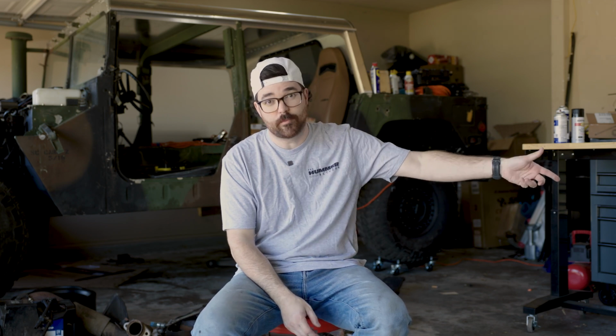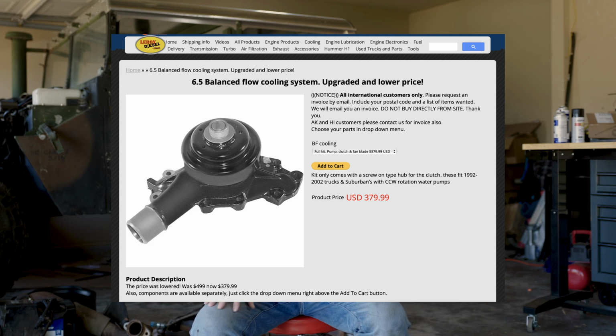So, that was the last video, where I did the fan. I got some feedback, started talking with some guys on the forum, and referenced a previous video, the water pump. Well, I put a new water pump on. I'm from the Jeep world. I didn't know there's reverse flow water pumps and the issues that can cause. So I put on a water pump. It's fine, it's clean, it's OEM. However, engineers discovered that part of the reason the back of the blocks were overheating is they weren't getting coolant. And there's this other water pump that I didn't know about. It's reverse flow, I think is what it's called.